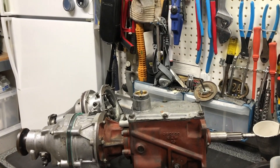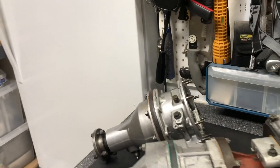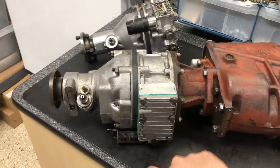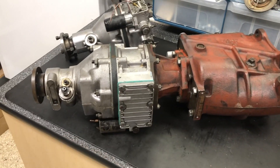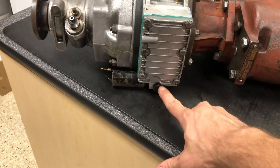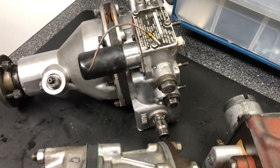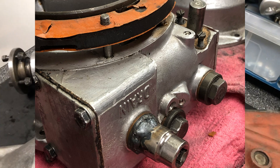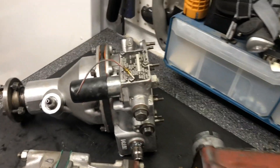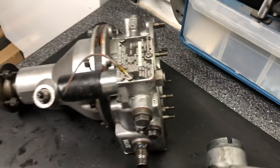It's 1.6 liters in this transmission. Looking at the bottom of the overdrive units: the J-type has little vanes, maybe to help cool some of the heat as air flows through. On the D-type you just have all the drain valves. There is a drain valve on the J-type as well, but the D-type has the drain valve labeled very clearly. I have a socket welder on there because it was stripped — it was so stuck when I went to reseal everything. And then there are two other valves as well as another spot for servicing.